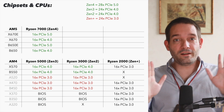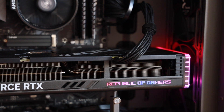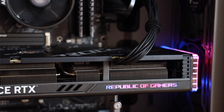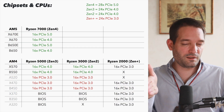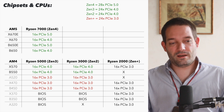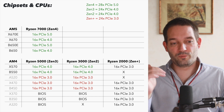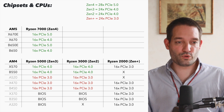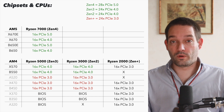If you're buying a modern graphics card from Nvidia or AMD, please make sure you have a PCIe 4 system — I think that's better, especially if you step down from the 4070 to the RTX 4060. The RTX 4060 only has 8 lanes, and you do not want to pair an 8-lane PCIe 4.0 card into a PCIe 3.0 slot. If you have a PCIe 4 GPU, pair it with a PCIe 4 system — that's an important consideration.